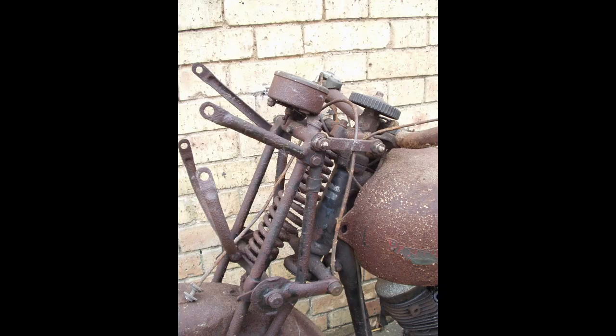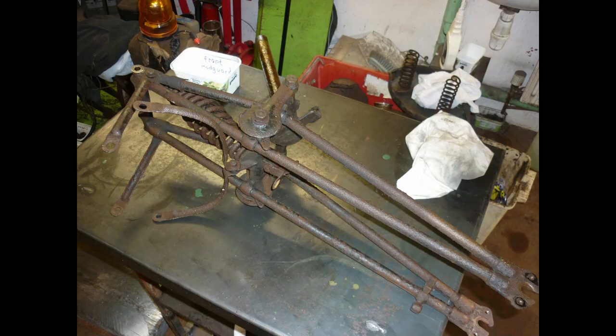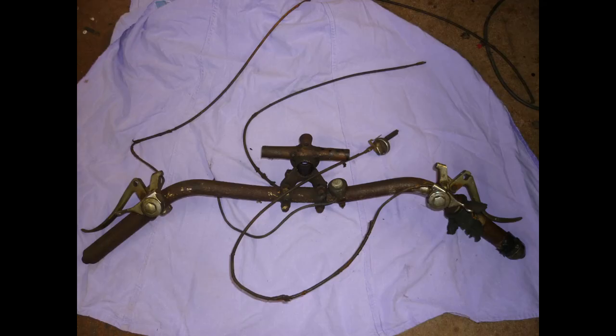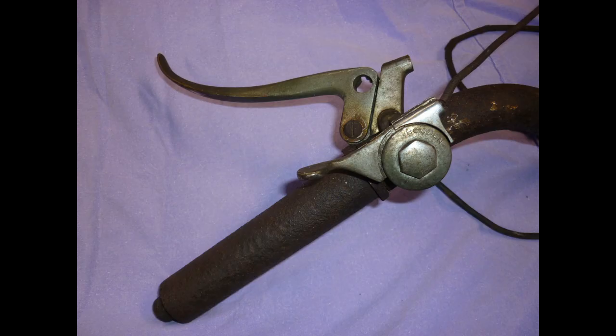Parts may be absent altogether, stolen for another bike. This Panther lost dynamo, AMAL carburettor and lights, plus random components of the web forks damper assembly. A distinctly down-at-heel foot brake lever pivot will need bushing to remove play. Handlebar grips are in a state of collapse, but near complete Bowden controls respond well to cleaning. POC friend Clive comes up with a missing lever for the left-hand decompressor and advance assembly.